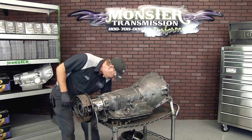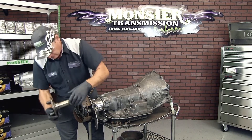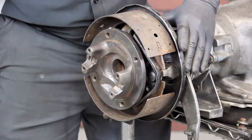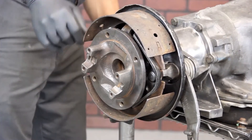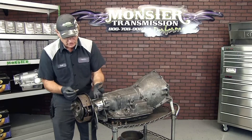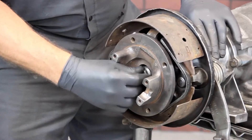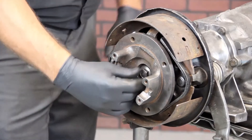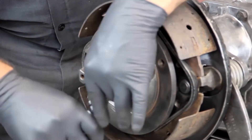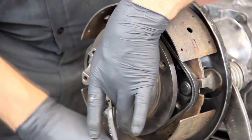Now that the brake shoes are lined up, you can slide in the yoke — slide it all the way in. There will be one bolt with a washer; make sure the washer goes in first on top, then the bolt goes right in the center. Torque to approximately 15 to 20 pounds of pressure. Again, no impact gun.